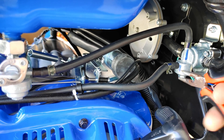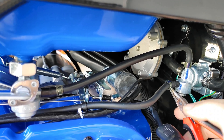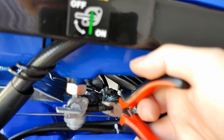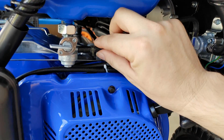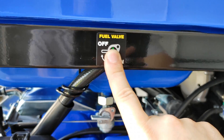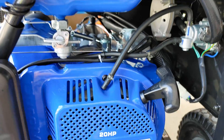It's pretty simple to bypass — I've already done it. I've already removed these hose clamps, which all you need is a pair of needle nose pliers. You can see I already removed them, so that's going to be much easier. Basically what you do is push on these and wiggle the hose clamp out from the fuel line going to your carburetor, and from the fuel line coming out of the gas tank. Please make sure that this fuel valve is off.